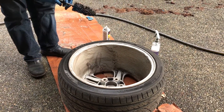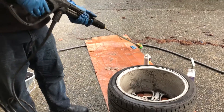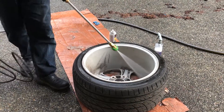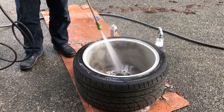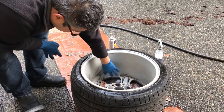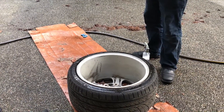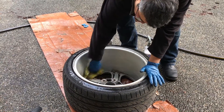The wheel cleaner has been sprayed on and dwelled. Let's use the sprayer to rinse it off. You'll see especially in this area here an example where adhesive has been dissolved and carried away by the solvent. What I can now do is take my microfiber, put some adhesive remover on it, go over that area, and you'll see it becomes clean.